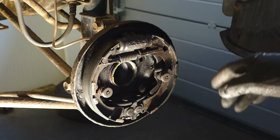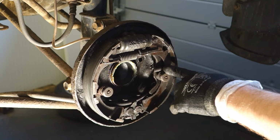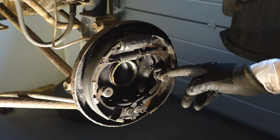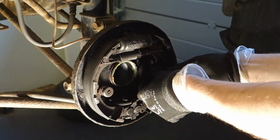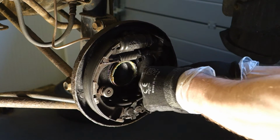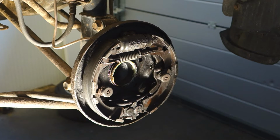brake pads away, and it happens so that there are those 2 locking pins, and first I press these pins down and I rotate them a little bit down with rotation, and it is maybe easier to open with tongs.